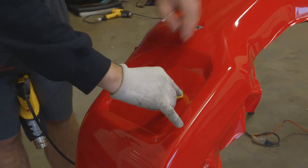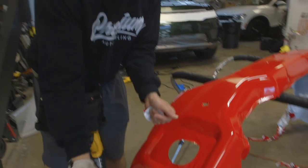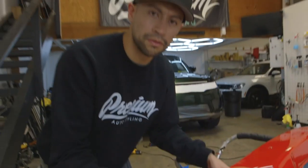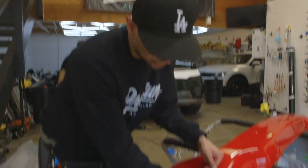With this I was able to just heat it up and push it down. As you guys can see, it's not too deep in there, but if it was a deeper recessed area we would probably have to do some inlays so that the film doesn't peel back on us. We're going to cut this out and shrink the material. Since we pulled this way we may develop some lines, but we'll leave about one-eighth inch of material excess left over and just wrap it.